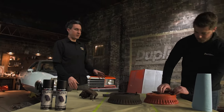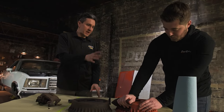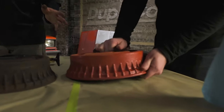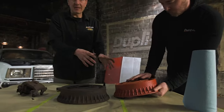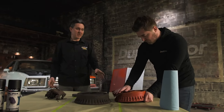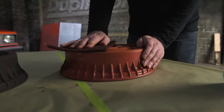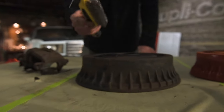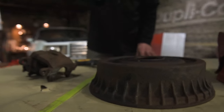Ben's going to continue to scuff up that drum because it was previously painted during a half restoration of the car. The key is to scuff it all down and get rid of that gloss — that paint has been baked on and sitting there for 10 years. We've got to break it down so the new paint has something to stick to. This brake drum is original to the car and tends to get really rusted over time. So I'm going to take the wire brush, knock the rust off, wet everything again with Dupli-Color caliper cleaner, and get everything ready for paint.